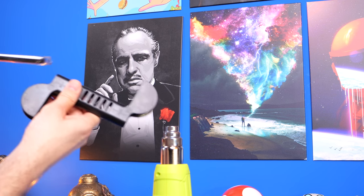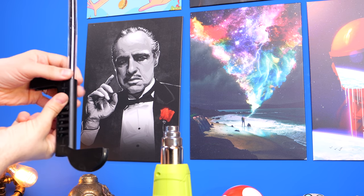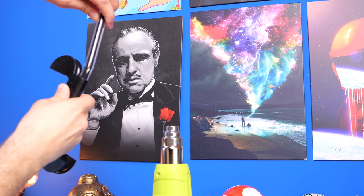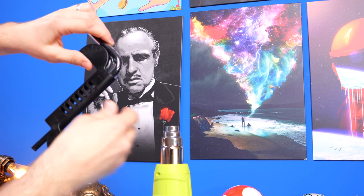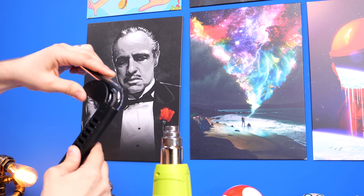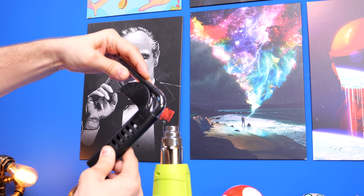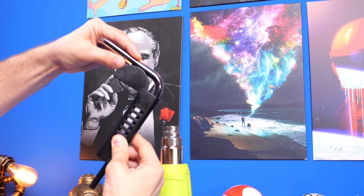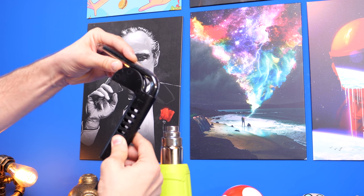Avoid using the hottest setting on your heat gun. You can have problems where it's either too hot or not hot enough on the sides of the bend area — it's a real trial and error process. Be ready that you might need to use some defective pipe as a test bench where you can just test out new bends. I ended up using some bits of pipe as placeholders to gauge what size I needed between the different areas.